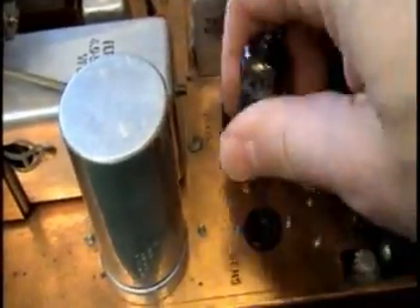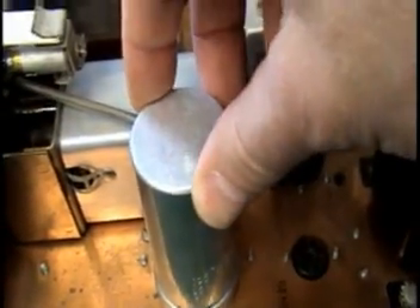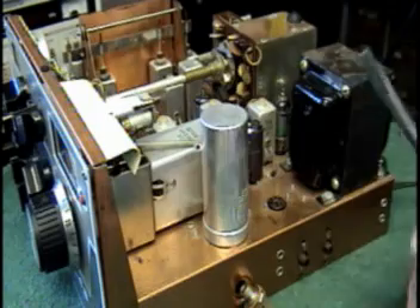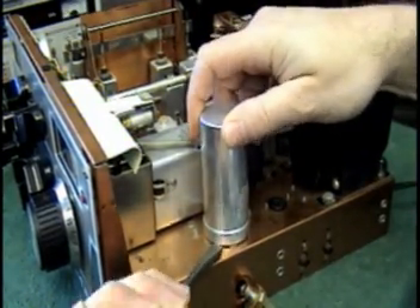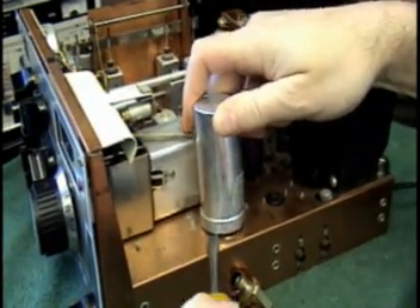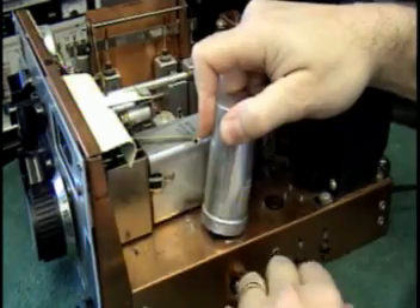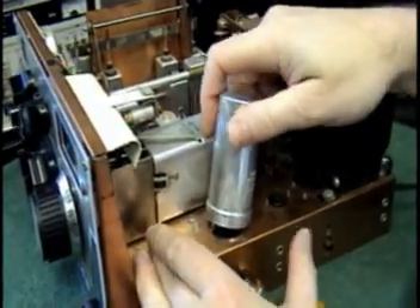We're back topside. A good idea is to remove your audio tube so you don't break it in the process of rocking out the filter — you can see it's already loose. So now it's time to rock the cap out. I'd recommend you use a screwdriver, get it under the edge, and just kind of lift — she'll come up, because it's just unbending those tabs. So now it's loose, just rock it, and it will fatigue that solder connection and it'll come out.